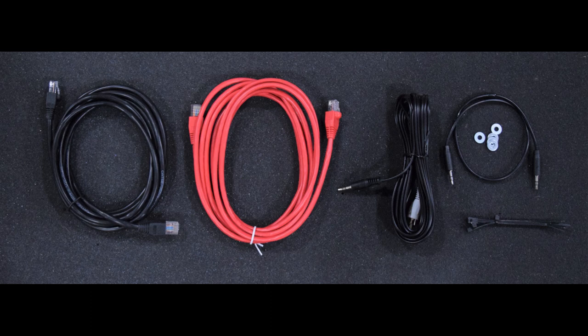If you are installing your CDU kit into a game without an existing Pinwolfer super kit, you will not need the 1.5 foot audio cable. If you are installing into a game with an existing Pinwolfer super kit, you will not need one of the two 7 pin rainbow colored jumper cables. Take note of this now and set aside the one cable you will not need.